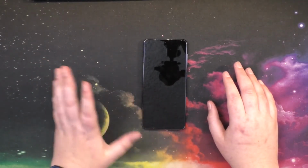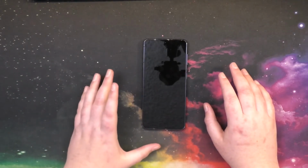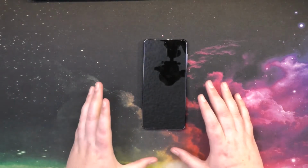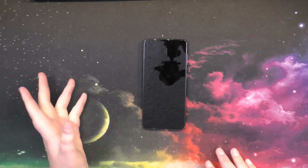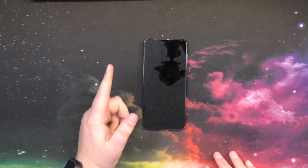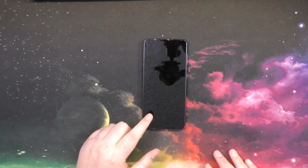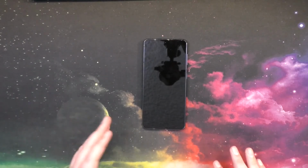It just completely ignores the SIM card when you put it in, and it completely ignores the firmware CSCs, which it used to never do. And it's really hard to change now. The only way I found to do this for free, because there are paid options, like SamKey, which is what I used at first and blew $10 on for nothing, because you can change it once, and then if you pop in another SIM card that comes from the originating carrier, in this case T-Mobile, it just reverts that change and you're back to a locked CSC for T-Mobile in my case.